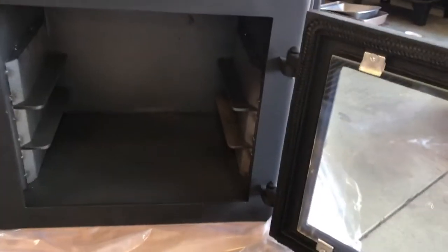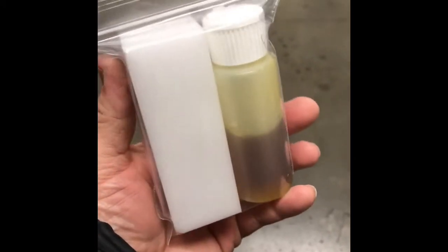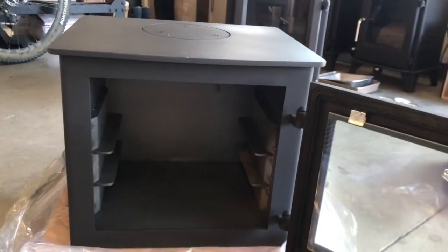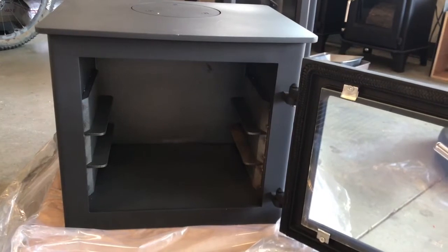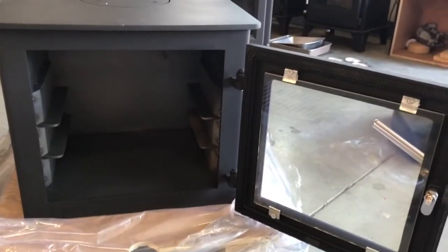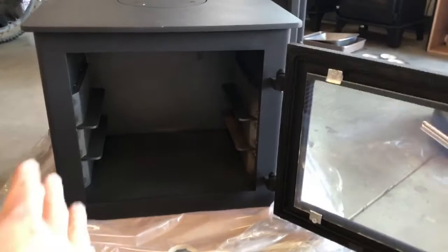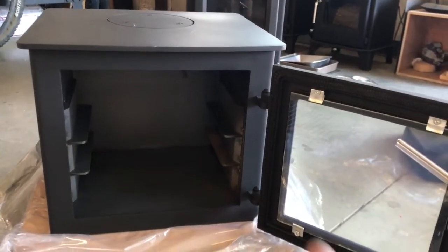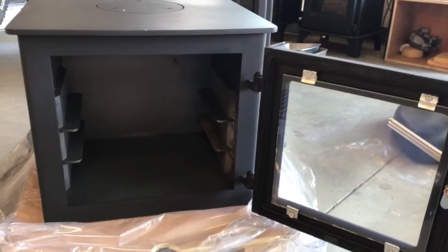You can see there's just a little bit of surface rust. Your stove will come with a little bottle of linseed oil and an applicator — you just rub that around to help cure the steel and minimize surface rust. You can also use a steel wool pad to rough it up. The nature of the oven interior means there won't be much moisture since the heat evaporates it. We wanted to do a stainless interior, but because the exterior is carbon steel we couldn't get consistent welds for a stainless interior box.